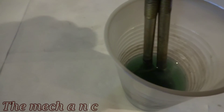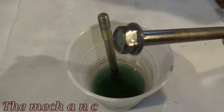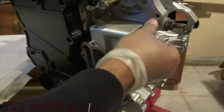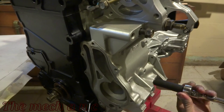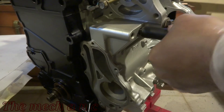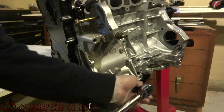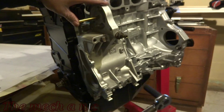It's been about 45 minutes since I put these bolts inside of the rust dissolver and as you can see they look great now, so I'm going to pull them out, rinse them off, and put them on the engine. To be honest I really couldn't find a torque spec for this, so I just set my torque wrench at 20 pound-feet and left it at that.